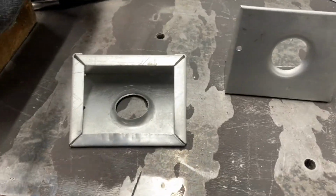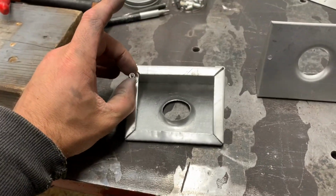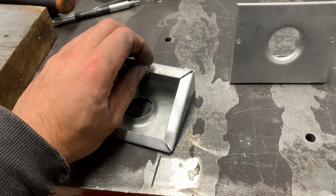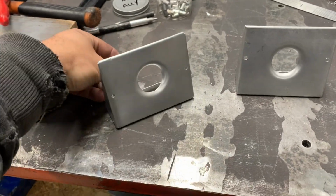And the back is going to be held on with these. Just a couple of riv nuts in there. Could use screws, but I want to use riv nuts. That's why I've made this flange 10mm, so they fit nice. Right then, let's get some carbon on the go.